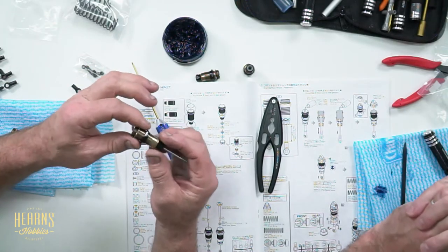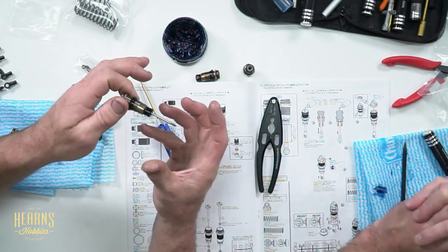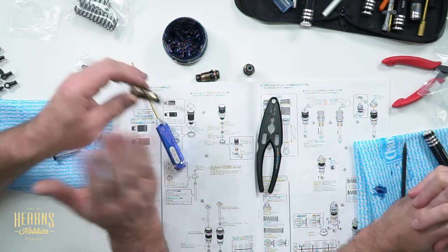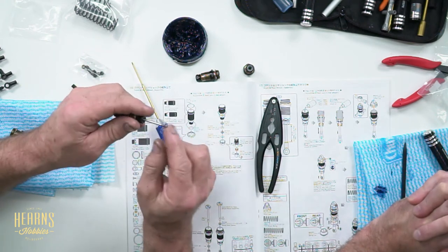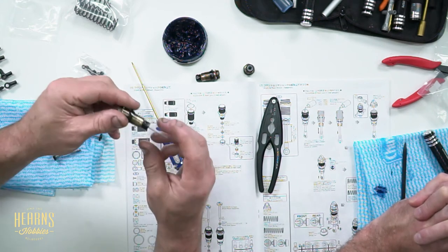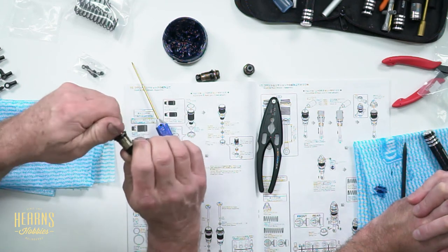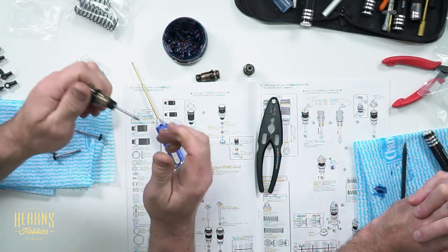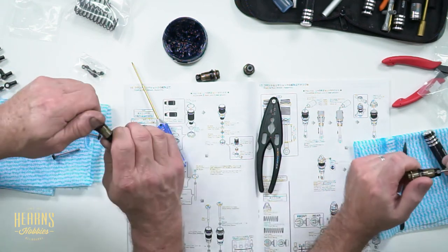So anyway, we slid the shock shaft in, and we've still got this part loose. Yep. And that's got no pressure on the X-rings and the guide, so it all just slipped through really easy. We just wipe the excess grease. And the other reason is the grease goes on here and it actually makes the ball end go on really nice. So now that's in. Just tighten that up so it's firm. Feel that. And you can feel it. Feel that. That's just perfecto.